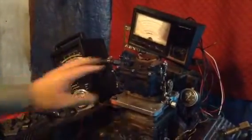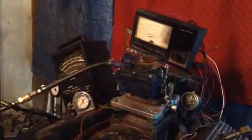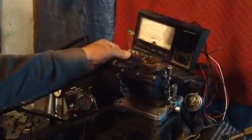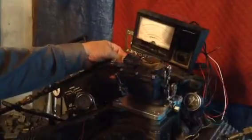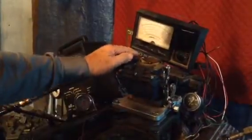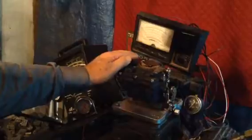First I want to talk to you about this blue finish — this is beautiful, but it may come off in the ultrasonic machine. If it does, we need you to tell us what you want to do. We also want you to tell us what you want to do about this antique choke. We'd like to convert it over to electric. It's $35 for the parts, and we don't charge any labor to put it in because it's going to be torn apart anyway. It just requires one wire to run it and it's very easy to work.